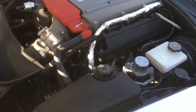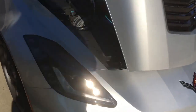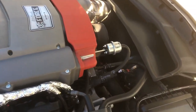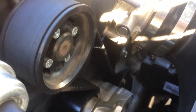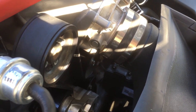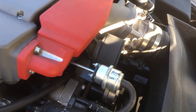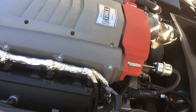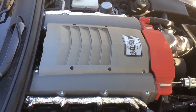Walking around over here on that side, I'll give you a look at things. I could drop a smaller diameter pulley and get more PSI — I think 5 PSI is all I'm getting out of this. I could go to 7 and get more horsepower, more torque. Torque is about 490, it matches the horsepower on the dyno curve.